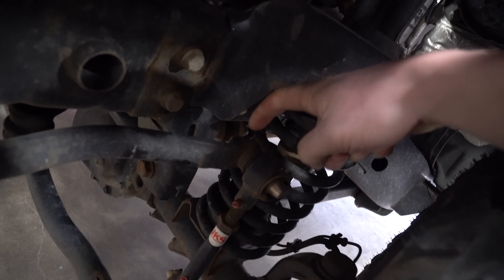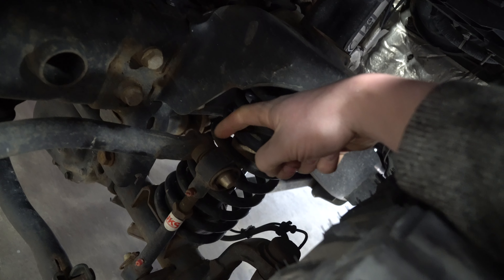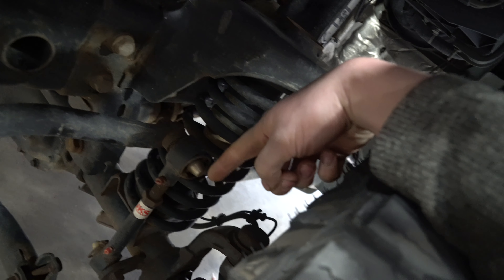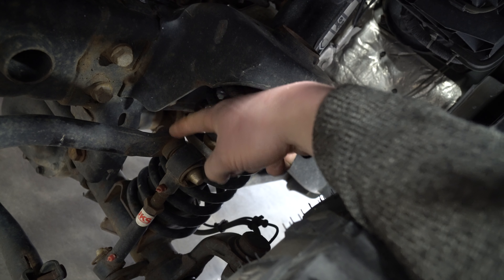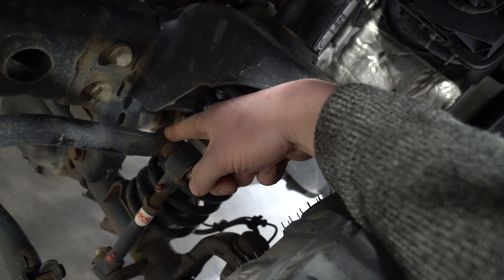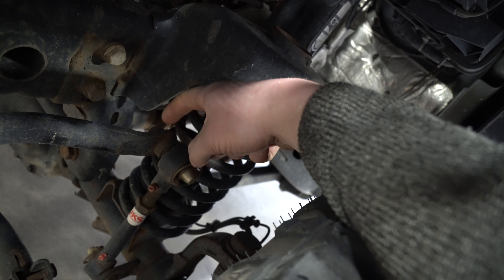It's hard to show, but all we've done is welded the bolt to the sway bar right here, so that way this locks in way better for the pin. Now what will happen is that notch that's worked its way into the sway bar will no longer wobble. It will actually have a sturdy hold on that nut since the nut is now part of the sway bar.